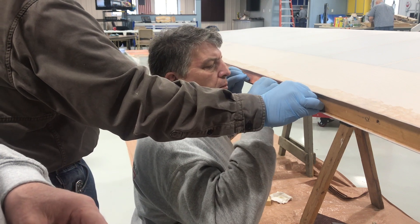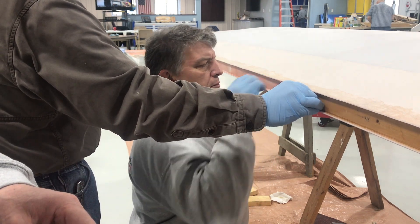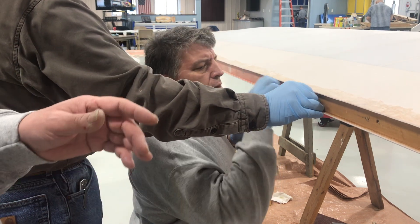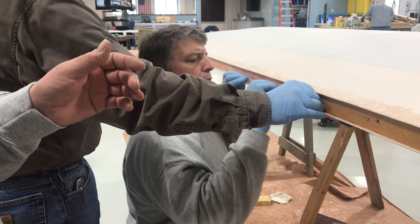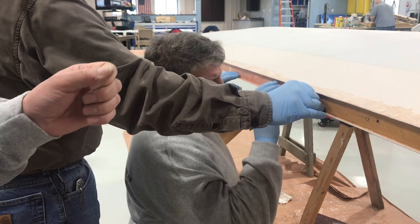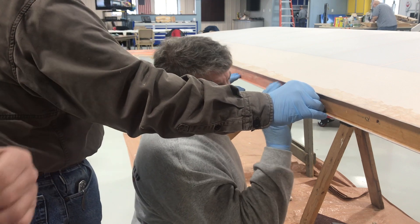You'll notice a little piece of aluminum — this was kind of an ingenious tool these guys came up with to tuck this in. Now once the fabric has got poly brush on it and cut into strips, this process works really nice. If it was raw fabric it would want to spring back, but we're not having that problem with this.